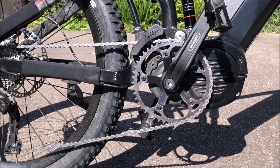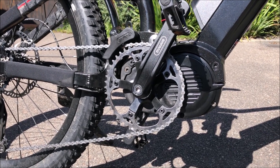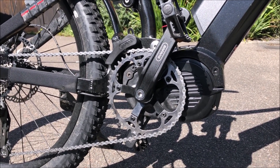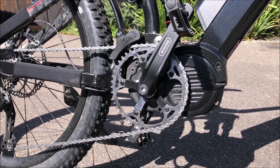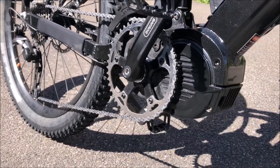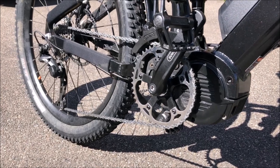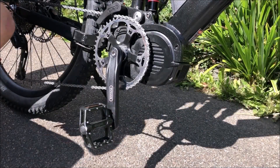My next job is to get the motor out. Several people watching videos of me riding the bike said my motor sounded particularly noisy, and apparently Bafang didn't grease the motor particularly well from factory. So I'm going to open it up, clean it all out, inspect all the steel gears, and re-grease it. I've got some Mobil SHC 100 grease and a new tube of that to fill it all up.